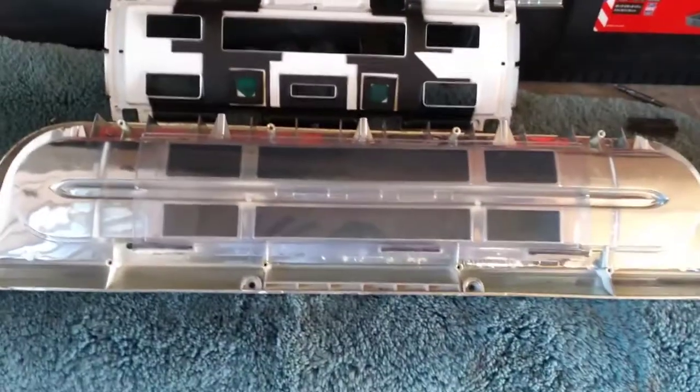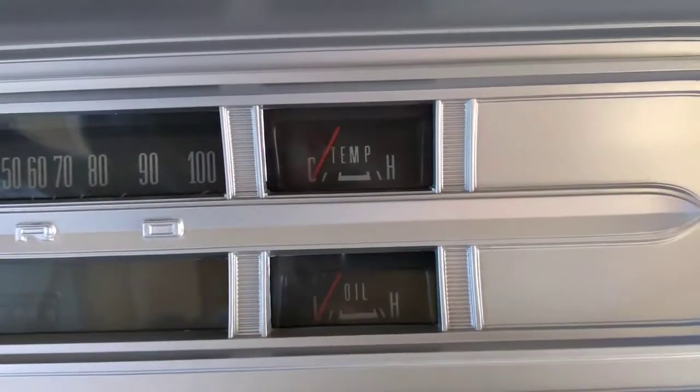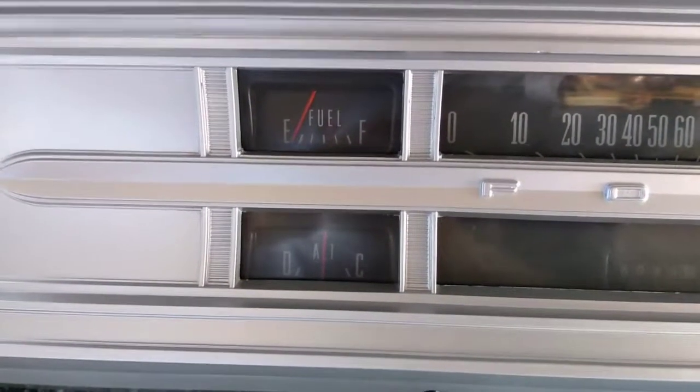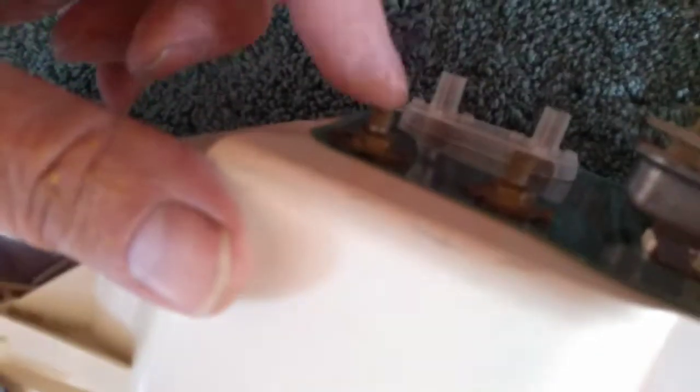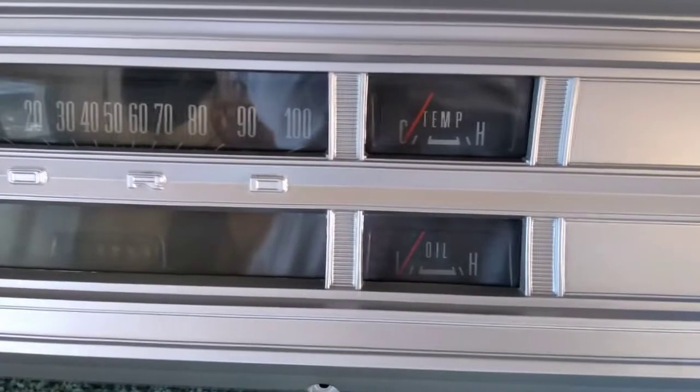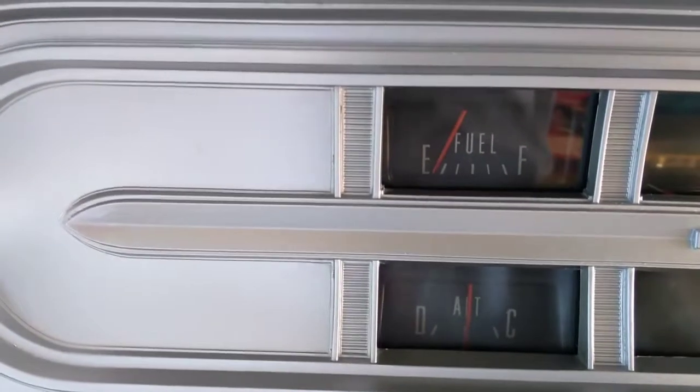So there we are. It's turning out really nice. We're back together. Got all 6 of our screws in this time, rated some from the parts piece. Oh yeah, I was going to tell you too, as I talked about, taking the gauges out of the other one because our needles were all faded. As I started to do that, I found out that they were completely interchangeable, except that the studs on the back of them where they came through were too short, because this new plastic design used longer studs for some reason. So rather than fight that, I just went back in and took the original ones out of this unit, and instead I found some orange paint and painted those needles on there so that we're all up to date and nothing's faded, and they're going to look really good.